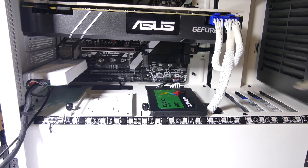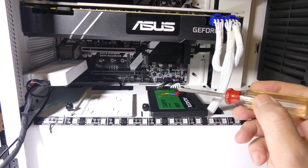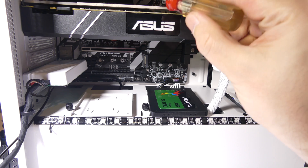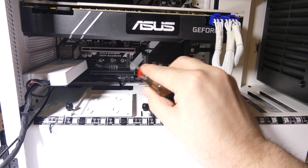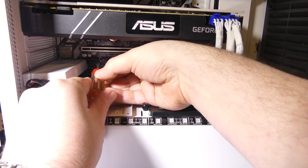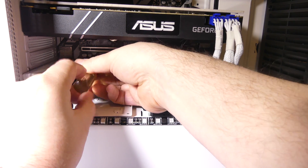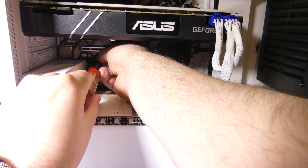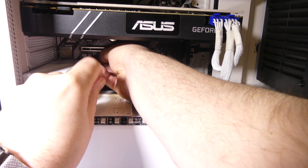This is the inside of the PC. As you can see, there is an existing SSD drive. This is not my boot drive — I actually have an Intel 330 as a boot drive; it's just not pictured, it's underneath. You will be able to see that there is an M.2 slot right here on my motherboard, and this is where the Samsung NVMe drive is going to go. There's also a screw already in the motherboard, so you just need to remove that screw. Most motherboards will already have that screw pre-installed, so you won't have to worry about one coming with the drive.